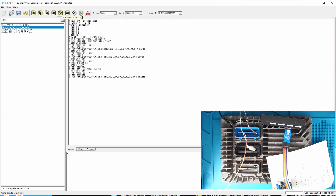I'm going to use this program button. It will do an extra erase — don't worry, it takes about 13 seconds to erase. The programming is slightly slower than reading: reading is about 30 to 32 kilobytes per second, and programming is about 28 to 29 kilobytes per second. Monitor the LED here — when we do program, the LED is blinking really fast, showing there's activity going on. If you see the LED stop blinking and no progress is happening, that means something went wrong, either the connection or power. I find the power is very sensitive. The setup works for me — hope this works for you as well.